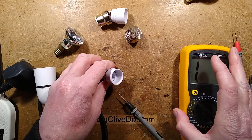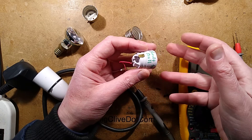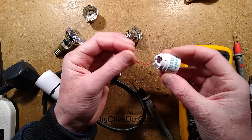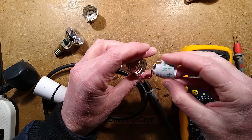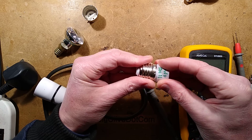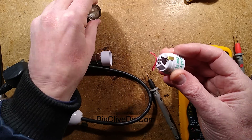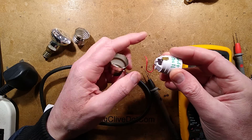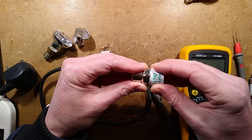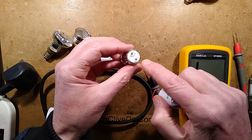Now, why has this happened? Well, it turns out that they've used a very simple system that is, in their eyes, compatible with Edison screw and bayonet cap. It has this arrangement where, if it was Edison screw, it has one wire at the back that goes to the back pin, and then the side of the lamp housing, with this metal tab, connects onto the metal housing of the Edison screw lamp holder. But unfortunately, they use the same thing with the bayonet cap lamp holder, but they've added an extra wire onto that, and they've put it in, but they've crimped it again with that little brass contact, crimped against the side of the housing. So by default, the housing will always be referenced to one of these pins.